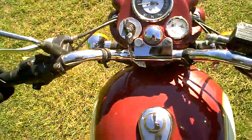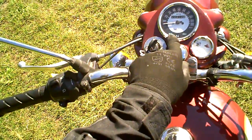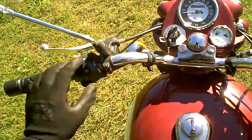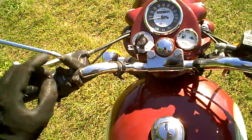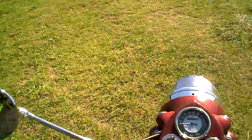I've been critical about the bike at some stage during the assembly — they've mixed up their neutral light with the main beam light. They both do what they should do, it's just that the bulbs are in the wrong holes. It's not worth doing much about it at this point, but if you ever have a look inside, you need to push out those bulbs and push them into the right holes.